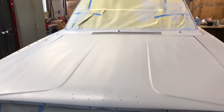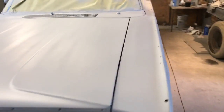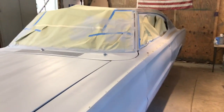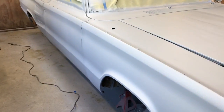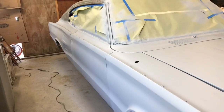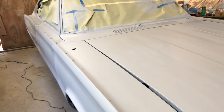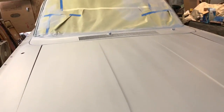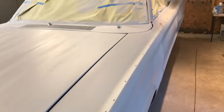You can see the sealer is a little bit striped — the gun was not playing nice. Anytime something goes wrong, make sure you blame the equipment, not the user. I'm going to tack cloth this and put on some color. I'll be using a different gun for the color, hopefully it works better. The gun I used for the primer has painted quite a few cars and it's getting tired — it leaks a little and it's problematic.